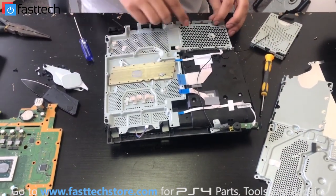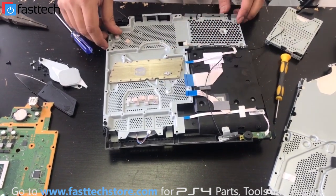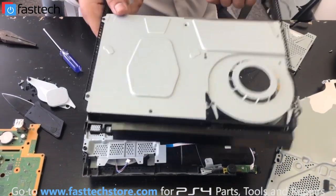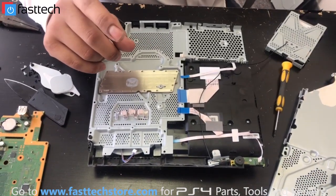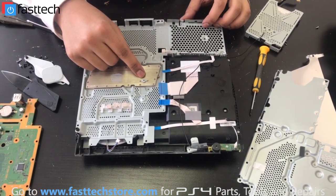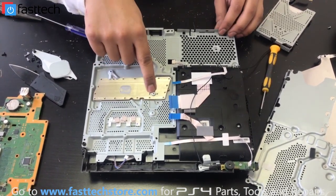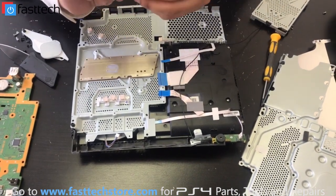So now we're going to remove some screws here — one here and possibly one more here — and we're going to take this plate out. We're going to have to take the disc drive out and the fan, and we're going to have to transfer it over into our new frame. We sell this frame on our website — we sell all parts for PS4s, I'll put a link in the description. On the newer PS4 Slim 2115 and 2100 units, there's this piece that sits on the heat sink — you don't want to lose it. Take it out and put it on the side; make sure you don't forget to put it back in.